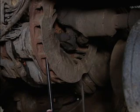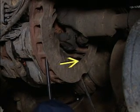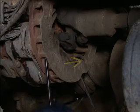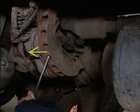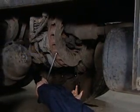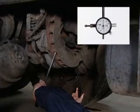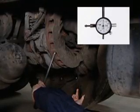Now we can use our medium screwdriver or small pry bar to check end play by putting it between the rotor and pole shoe at the bottom of the Telma. Pry gently back and forth toward the front and rear of the vehicle and also try to pull the rotor in and out. If there is any rotor movement compared to the stator, we want to measure the total movement with a dial indicator and record it.